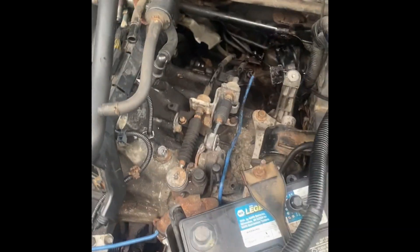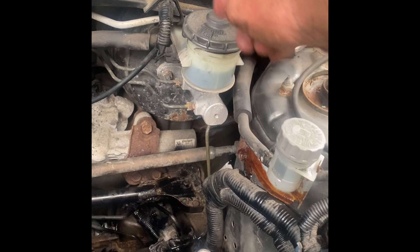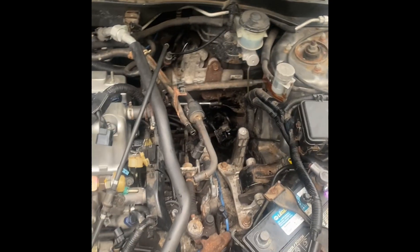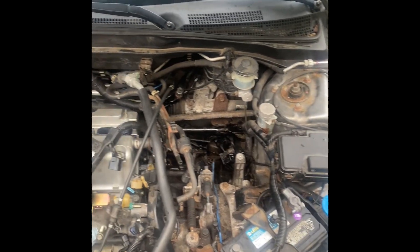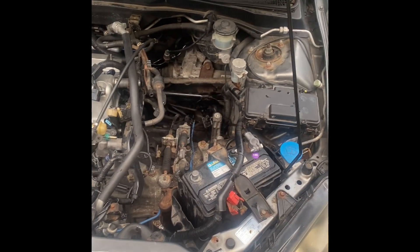All the axles are popped in and she's back on all four tires. We hooked the clutch back up but had no pedal. I figured out it works just like a brake caliper — there's a bleeder on the slave cylinder for the clutch. Open that up, and your reservoir is connected with the brakes so you just use brake fluid. Let it bleed and run out, and now we've got a nice strong clutch. Let's put it all back together.